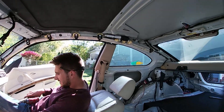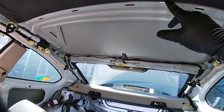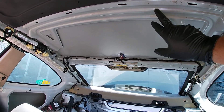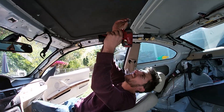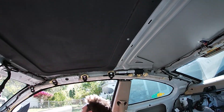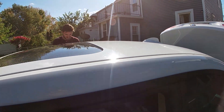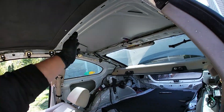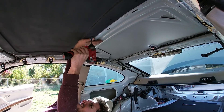Next, you need to get yourself five quarter-inch self-tappers and you'll put them in through these holes right here, which go into a double-layered metal right there and hopefully not your roof. Milwaukee M12 has a sheet metal screw setting — this is the first time I'm ever going to use it. We're good, it didn't go through. No denting.